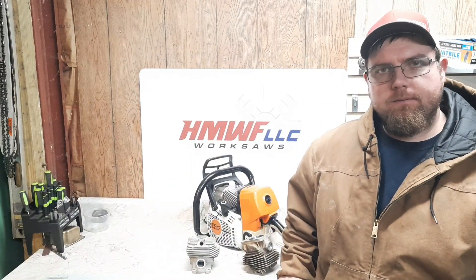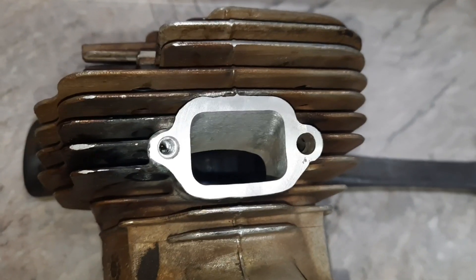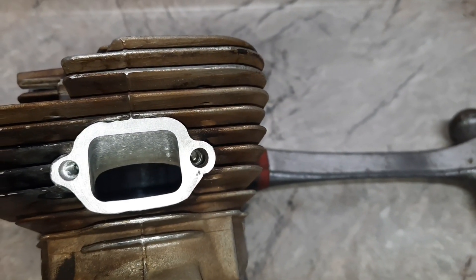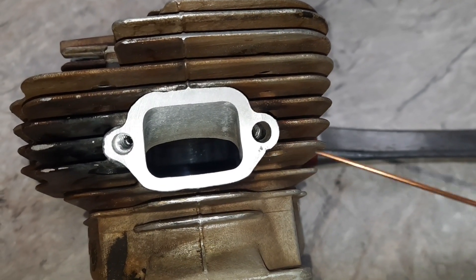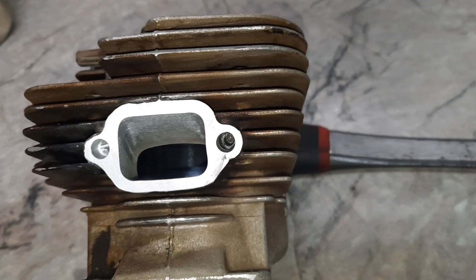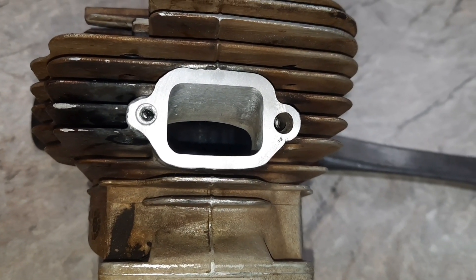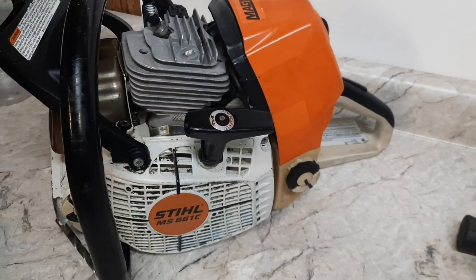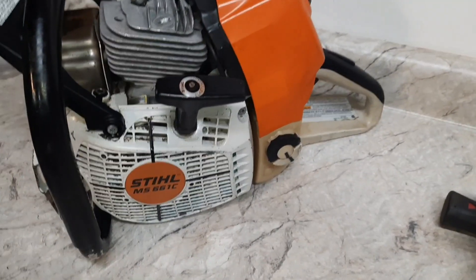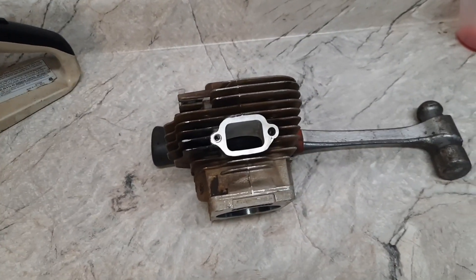If you want to see more repairs like these, leave a comment and let me know. If this is your type of video, hit the like button and make sure to subscribe so you can see more. Here's the finished repair — nice machine surface, just have one little pour over here but that's well out of the gasket sealing area. Everything blended in nice, tapped nice. This should bolt on like a stock muffler again. It'll be going on this 661 I just picked up — this is a bone stock late 2014 model. I'll get some baseline runs on this, then put on this ported cylinder. Let me know what you think.